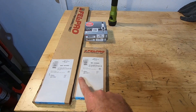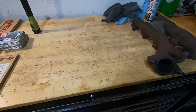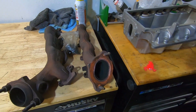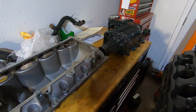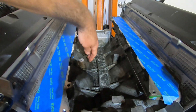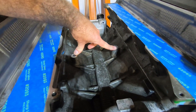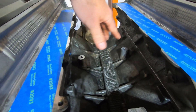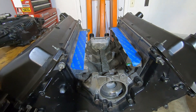I've got an intake manifold gasket and an exhaust manifold gasket. I'm going to put some spark plugs in there and put these factory manifolds back on there because he just needs to get it in the car so the car can be driven. I'm going to test fit this lower intake manifold on there and the Eaton M112. One of the problems with the LS-based engines is these bungs for knock sensors — those are going to have to get grinded out. I'll test fit the lower on here to double check, but I'm pretty sure that's going to have to be grinded off.